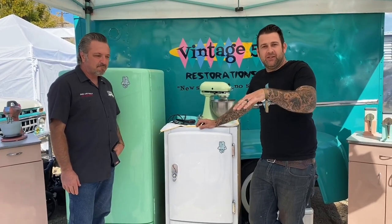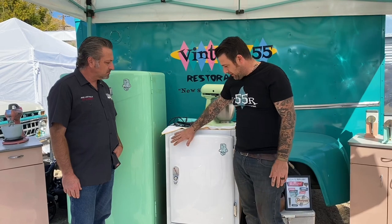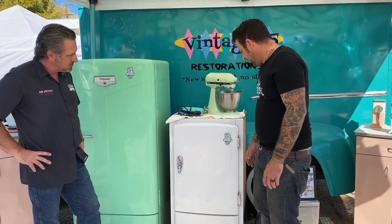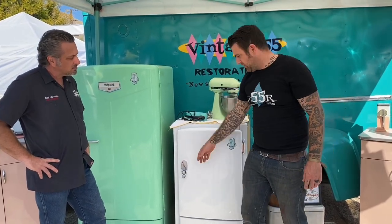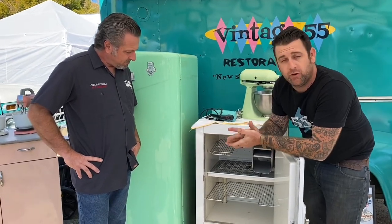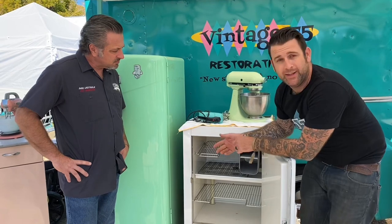Speaking of which, that's another refrigerator you see in trailers a lot — Servels — but those are gas. This one specifically you see a lot in 50s trailers, and there are two different versions: one has a little hook handle, one has a push button that ejects it. The cool thing about these is that they're 110 and an icebox. The difference is if you're on 110 you have to be plugged in, but if you have a 12-volt system, propane system, or alcohol system you can be unplugged and have your fridge run. With 110 you can't — once you get on the road you're done cooling.